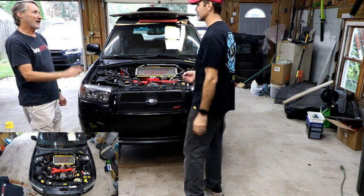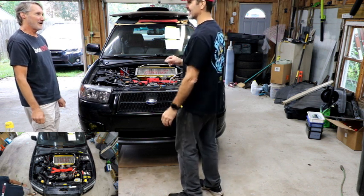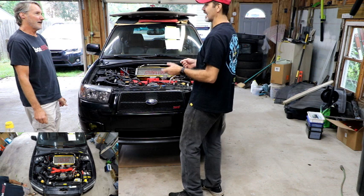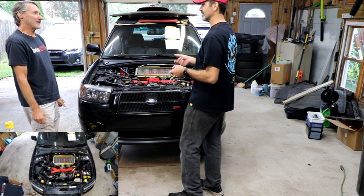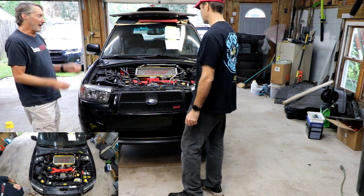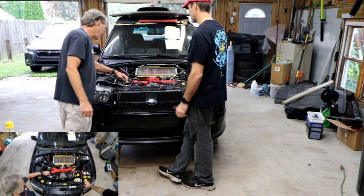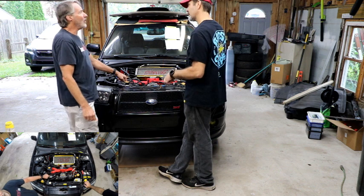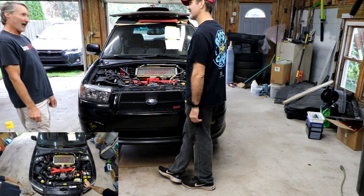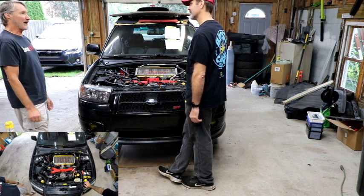It's like it was a stock body just with new internals. What clamp did you use? Everything that was with the kit — actually I bought it used, it just literally dropped right in place. The only thing I had to do was the sock for it. I had to order one because it's a little bit longer and I couldn't get it from the Subaru dealership without buying the whole pump, so I found one through Delphi and it was identical. I used the spring clamp that was already on — I just slid it up and pulled the pump out.